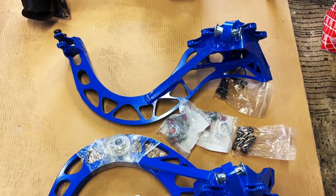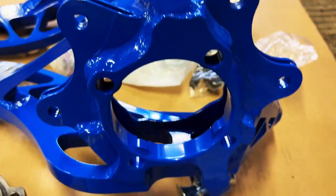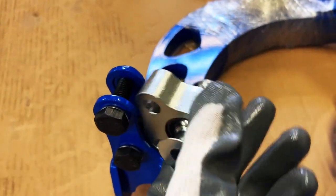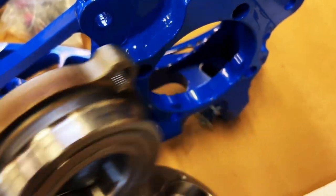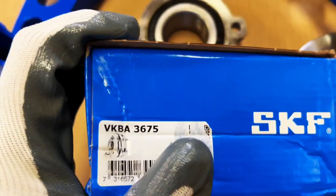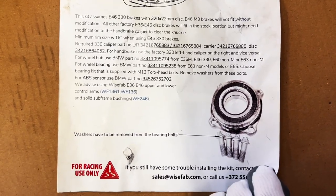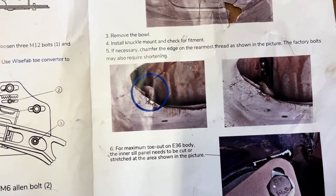Let's have a look at the contents of the box. Obviously you get two trailing arms which already have the sphericals installed, and it has dual caliper brackets — that's super easy and a lot stronger than stock. You'll need to get 7 Series or 6 Series wheel bearings; we'll provide you with all the part numbers for that. The hubs have splines for the axles and take your wheel bolts. This is the part number for the bearing we used, and every Y-swap kit comes with very clear instructions. People who buy from me are also added to the Y-swap info group on Facebook.